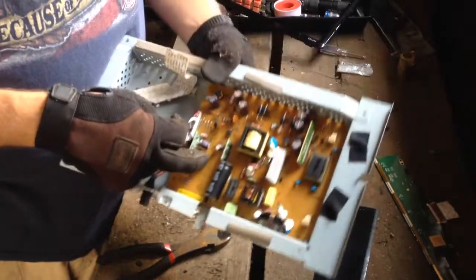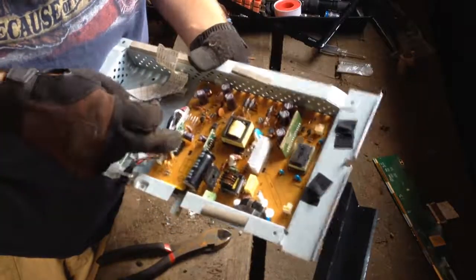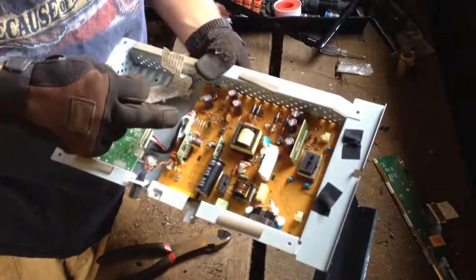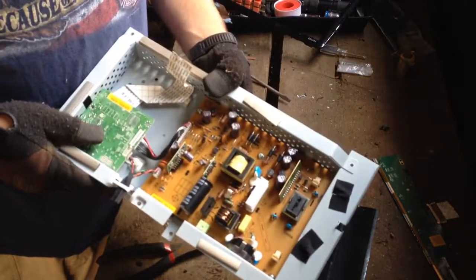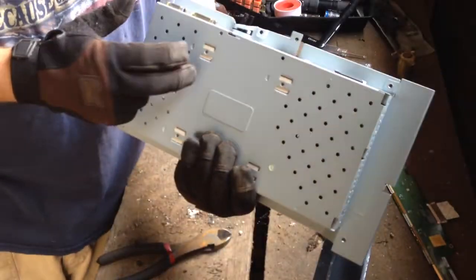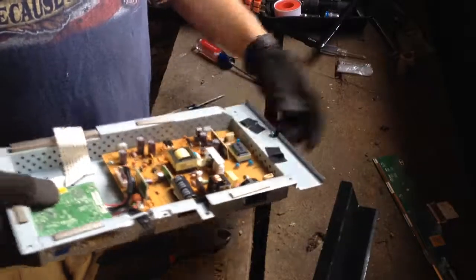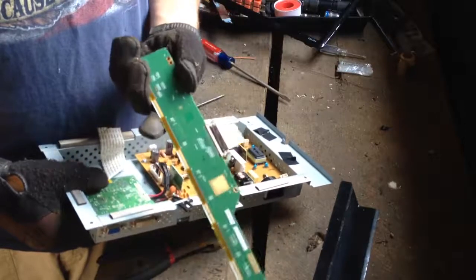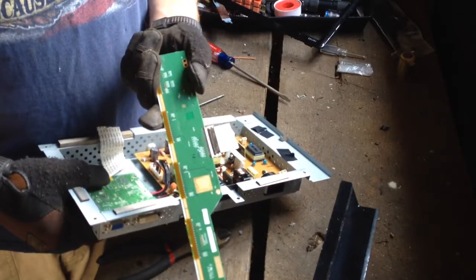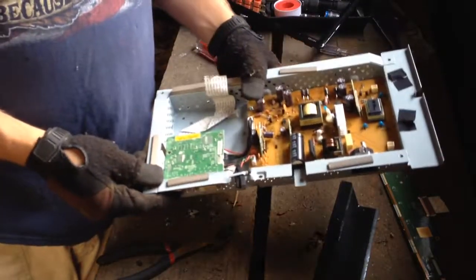Looking from the back here, that's going to be brown on both sides. That's a low grade board, but you're going to have some copper-bearing items there. No E-PROMs or anything that I can see on there. A heat sink there, but the rest of that board is going to be just a low grade board. And then you have some steel here that you can put in your regular shred steel. But the most important thing is to get that gold-bearing board off the back of that monitor — that's going to be the money maker off of scrapping your flat screen monitor.